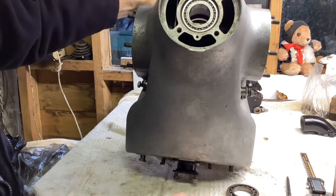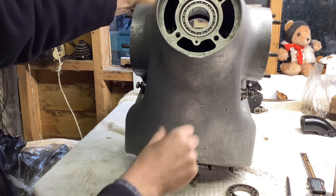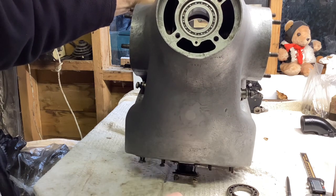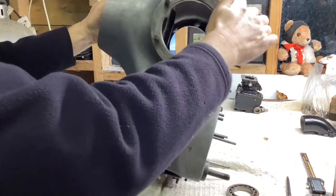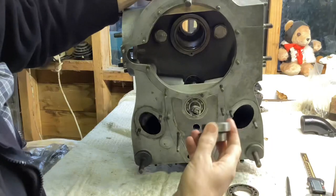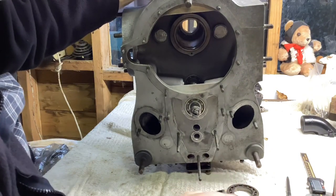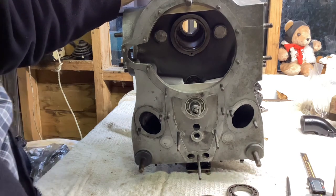They don't have any cooling fins on the crankcase either, but doing it that way is clever. It did make it a bit of a sod when it came to changing the camshaft bearings. I have put new bearings in — less than £10 for brand new SKF bearings, exactly the same as the original. Why wouldn't one change them? I had to make a hook arrangement, heat the crankcase up, and use a puller to get that front bearing out. Once the crankcase was warm and expanded, the bearings went in and out very easily.